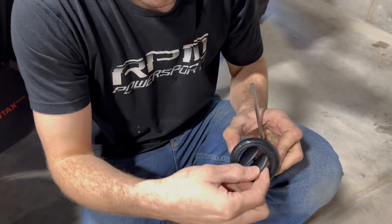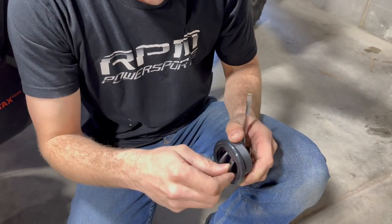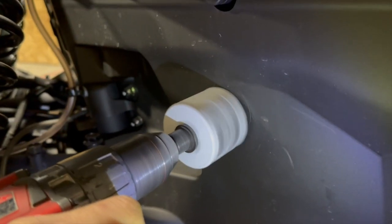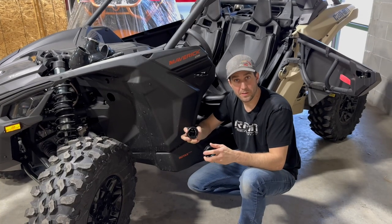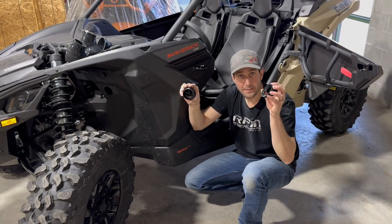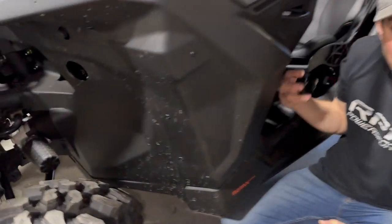You can put yours lower if you want it lower on your feet. Remember, these are completely adjustable — just push it, close it, point the air down, up, wherever you want it. These are completely adjustable, so let's knock a hole in this thing. The hole's drilled — it was really that easy. Next we're going to put this on the inside, push it through the firewall, take the nut, clamp it down. Simple as that — there's no specific position or orientation required.